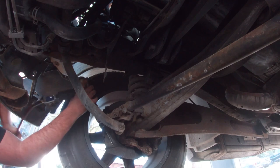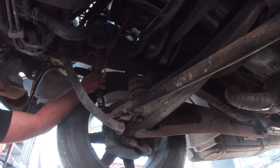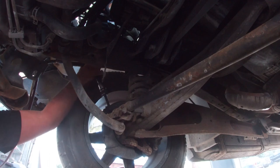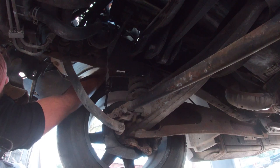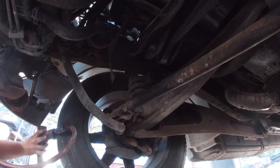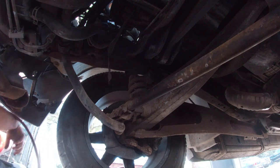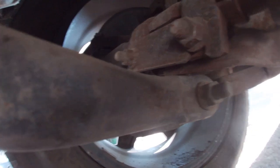This is true laziness — realistically any sane person would take off the tire, but I'm real lazy and I don't feel like doing that. What I will say if you're doing this job: I noticed this when I was starting on this one — make sure you put your adjustment sleeve 180 degrees out. This one was hitting the sway bar link.